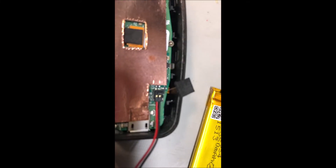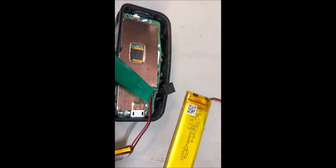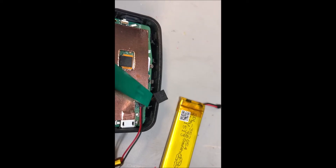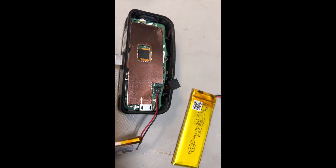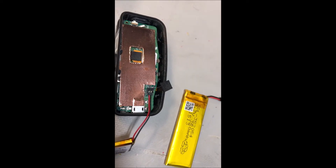The lead on the original battery is far shorter than the replacement one they give you. This connector in particular pops straight up — it doesn't come out sideways. That's why I ended up breaking off the piece of plastic on the other side, a little retaining clip.